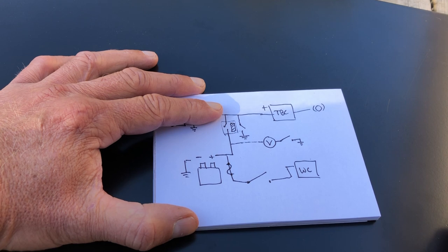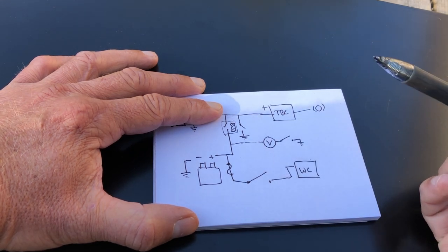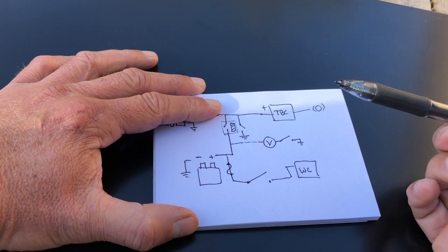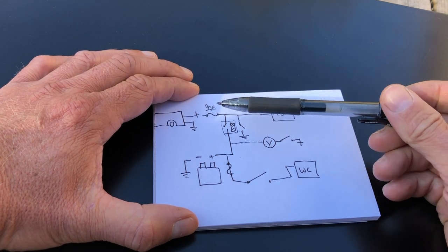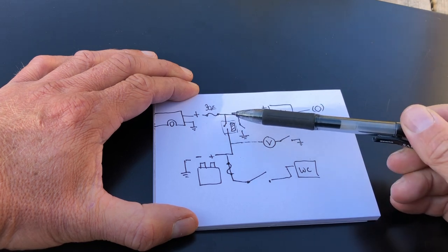They recommend a 660 cranking amp battery. So this might even be 600 amps worth of resettable fuse. Who knows? It's going to be in line, and it's going to protect the winch. It's going to protect the electricals. This 30 amp auto reset fuse here will prevent too much power from being drawn.